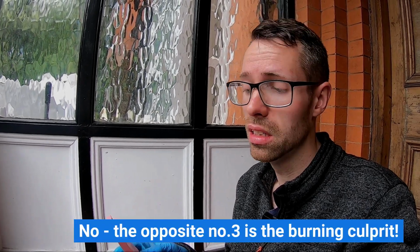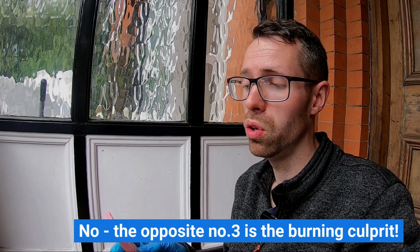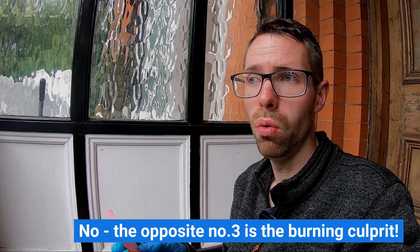It's still 88 after the wet test. That's rather interesting. So maybe cylinder number 3, therefore, doesn't have any piston issues, according to that, because the actual oil didn't make a bit of difference. Or is it because it's so worn that it really didn't make any difference anyway? I'm not sure about that one. Cylinder number 4 has gone from 88 to 99.